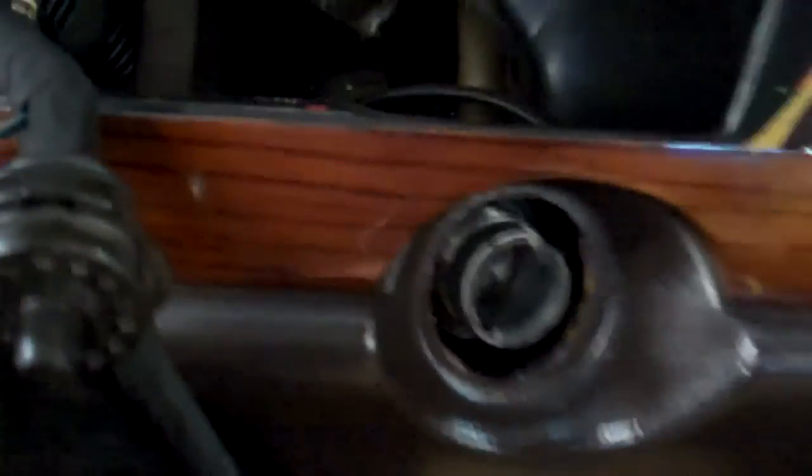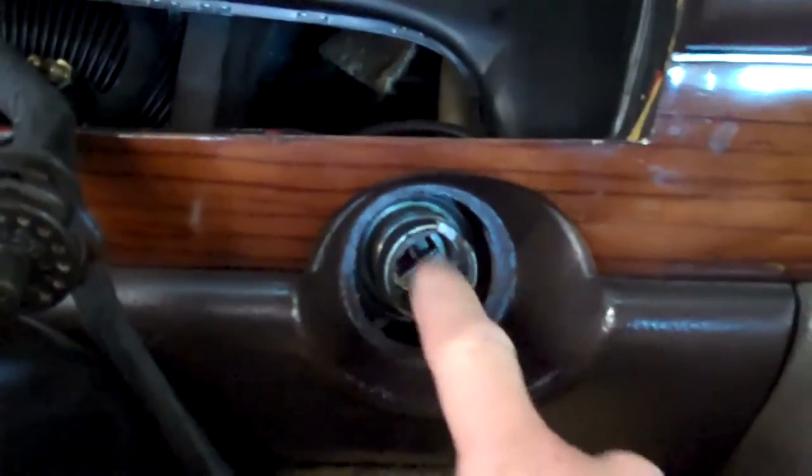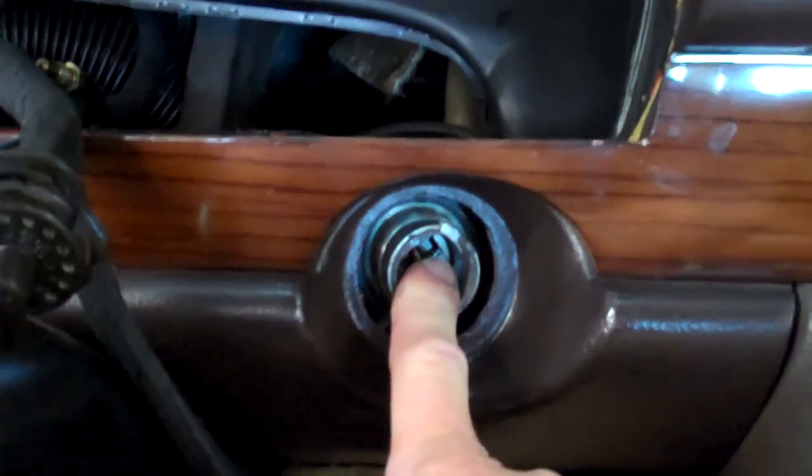Hello, Aminu. This is your car. We have it over here. The reason why your car was hard to start and your ignition was freezing up is because the key lock that goes in here went bad — it was worn out.